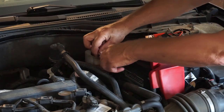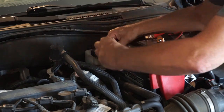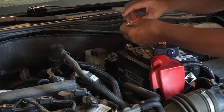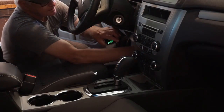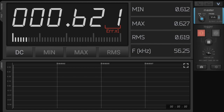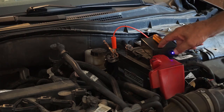Now we can disconnect the terminal and connect our parasitic logger. And now we can disconnect our memory saver. I've set the record interval at 60 seconds. Start logging. The lithium battery pack in here can last for hours — round the clock if need be.